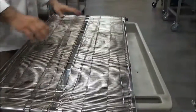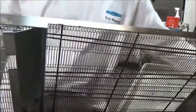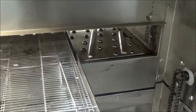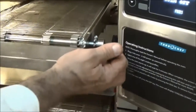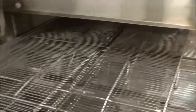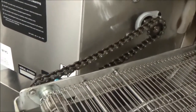Now we're ready to place the belt assembly back into the unit. With both cogs facing the unit, pick it up — notice the indent spot where it slides over the oven cavity. Line that up as best you can and just slide it into place. To connect the chains, start with the right-hand side: lift up, push forward a little bit, then pull it back so it seats. Now we're connected. On the opposite side, lift, place, and set down. Now the belt is connected and ready to operate.